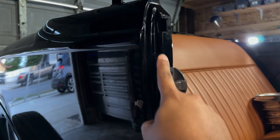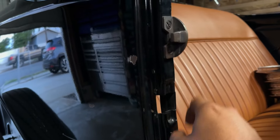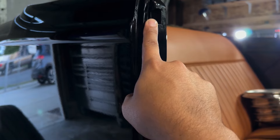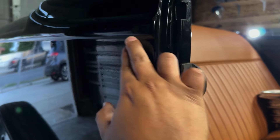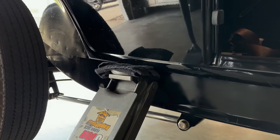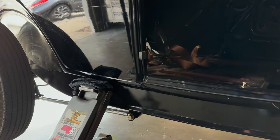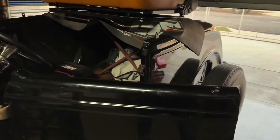When you're shimming your body, the only piece you want installed is the striker assembly. Don't have your rubber bump stops installed and don't have your dovetails installed just yet — just get everything lined up, because these will eventually affect the way your door closes. Your dovetails need to be adjusted after your door and body lines are set. If you're wondering how I'm doing this on my own — those bolts are all loose and I'm just putting ever so slight pressure on the bottom lip of the body to lift it up and give me enough room to slide the shims in.